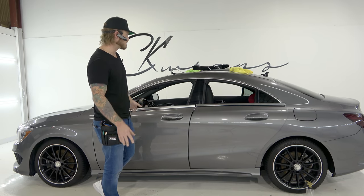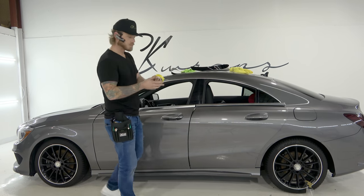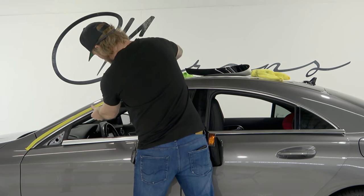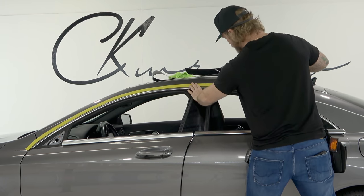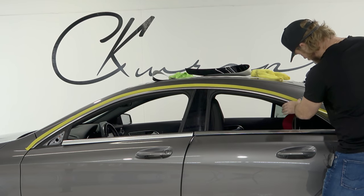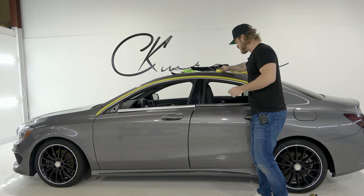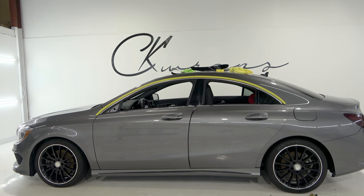This is going to look really good when it's done — it'll clean up the entire vehicle and give it that nice blackout package look. Now that we have our pieces cut, the next step is to wipe and prep. We're going to take some masking tape and apply it to the top edge here, running it as close to the edge as possible without overlapping onto the actual chrome trim. If the tape is on the chrome trim it'll be underneath our wrap, and we don't want that. We want to be wrapping on the chrome trim, not the tape. The tape serves as a safety measure and makes the job easier — I'll explain its role when we get there.